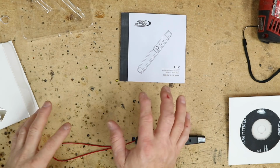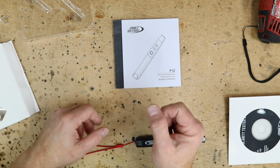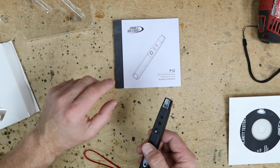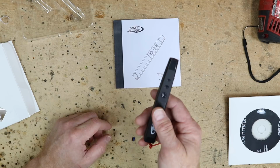This was a pain. They could have done a little bit better job as far as making this hole for the lanyard. All right, so according to the instructions, which is like most polarity testers that we have, we put the CD in, we play the track, it's gonna go green, green, red, or red, red, green. There again, neither one is wrong as long as all the speakers are doing the same thing. Let's go into the car now and we'll give this thing a test.